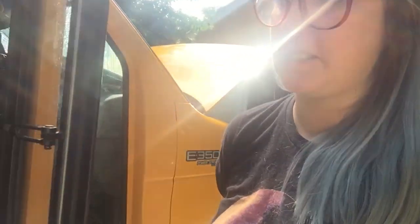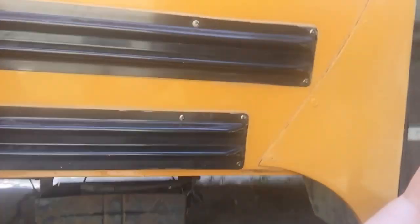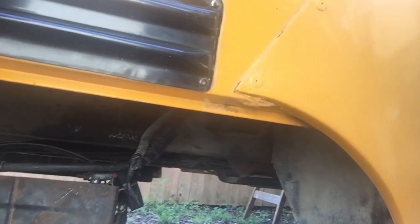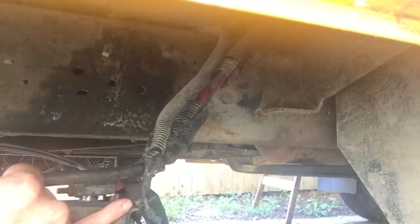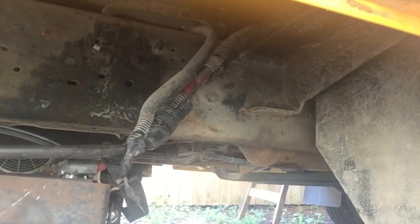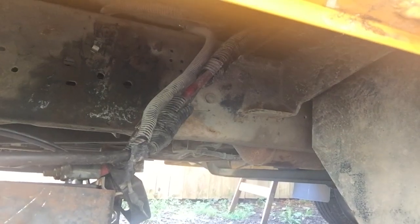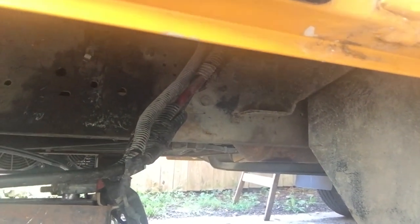There are portions, this is where, next to the door, our second battery is. I don't know where yours is. And right now, we've got it taken down off of the tray, because it just sits in this tray. But then we had this wire here, this is what was powering all of the emergency lights and things like that. So we just disconnected that from the battery, hooked the battery back up, and it pretty much got rid of everything that we wanted to get rid of.